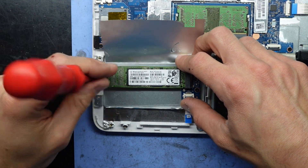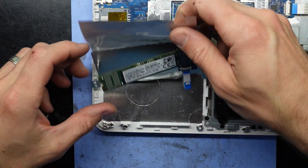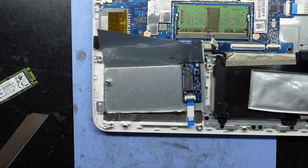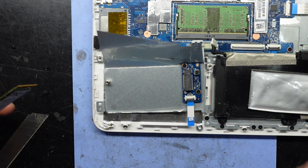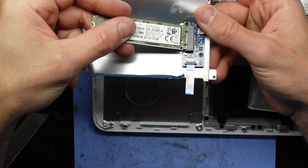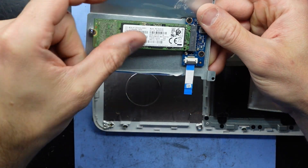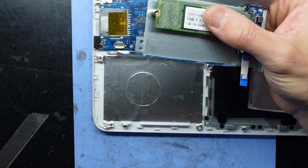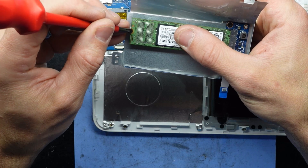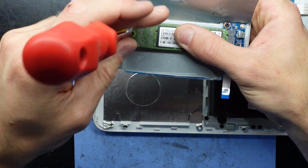If we were to replace it with another M.2 SATA SSD — I don't know if NVMe would be compatible, I'm assuming it's not but I may well be wrong. To remove it: disconnect the screw, it lifts up and flicks up, pull it out. To reinstall: line it up at a slight angle, note the notch, push in, push down, screw in.